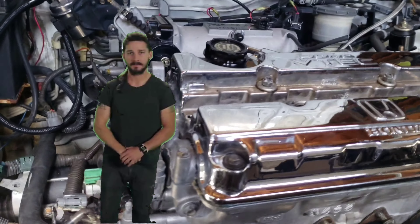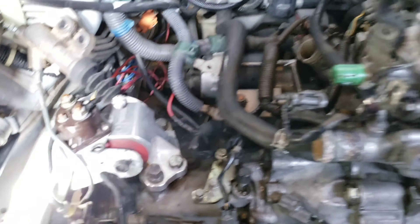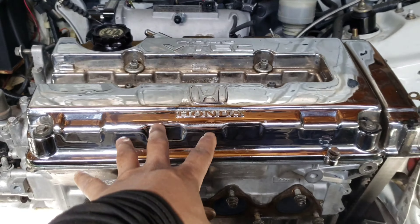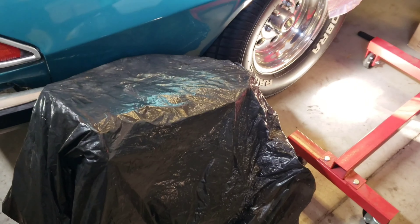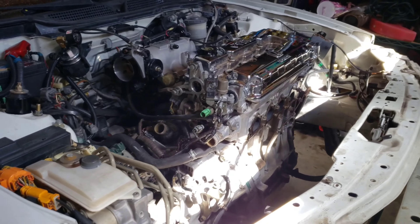Get the ones on the bottom and then just leave that one at the top. This thing is pretty much ready to drop — the next time y'all see this engine, it's gonna be on the ground. This tank is ready to go. All I got to do is loosen, pull the long bolt out, and take off this torque dampener — I forgot to take that off. Remove this torque dampener and then just loosen these two 17mm bolts from the top, put a floor jack underneath, and this whole engine and trans will lower down to the ground. So the next time y'all see this, it's gonna be sitting on the ground, and then I'll expose my new build. This is day two — thank y'all for watching, like and subscribe. Day three it's gonna be on the ground.